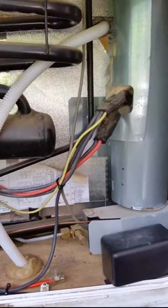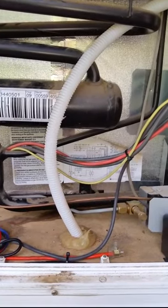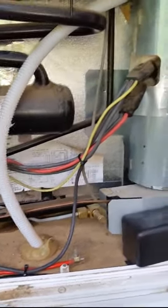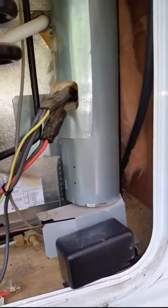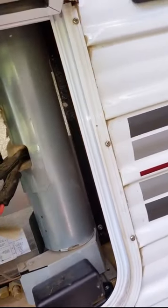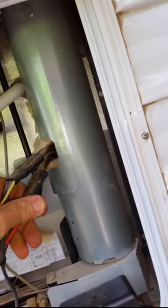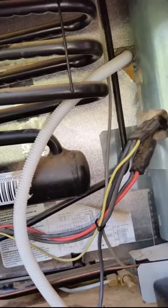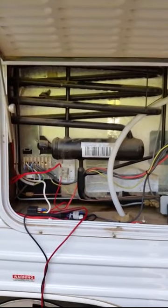It's quite interesting checking the heat in these wires - no wonder they don't work on most caravans. Any additional loss through inadequate wiring, poor fuses, and connections will significantly degrade fridge performance. You can't afford to drop one or two volts because the heater simply won't work efficiently and the fridge won't maintain its cold. That element is really hot now - this is the 240V one at the top not doing anything, and this is the 12 volt one working like a charm.